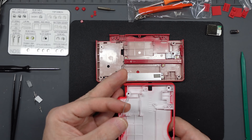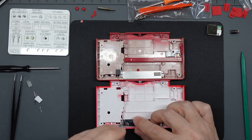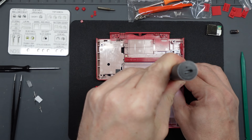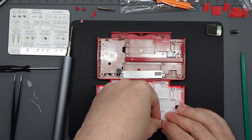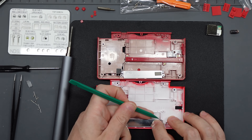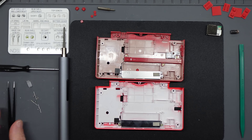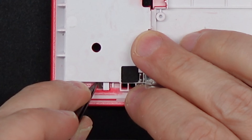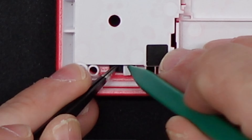Next up, moving on to the rear shell — there are a few bits to put in place before putting the whole thing together. The ground shield first: peel off its plastic backing and lay it in place as shown. I used the existing screws and all the new parts in this build. With those two screws in on the new shell, find the small self-adhesive squishy metal rectangle and stick it in position in the same way it was on the original ground shield. From the strip of black self-adhesive pads, there is a square piece that goes just to the left of where the ground shield is on the lower right of the battery compartment. Then find the rectangular nut which holds the battery door in place — make sure you get that nut in position because that is what holds the battery lid screw. Slide it in carefully, you might need tweezers, and then use one of the rectangular stickers to hold it in place.